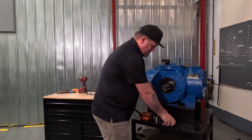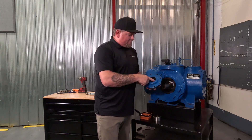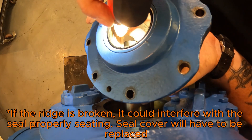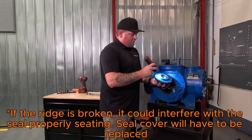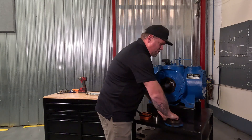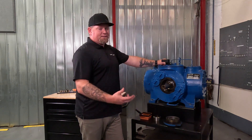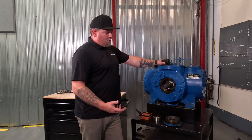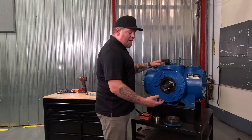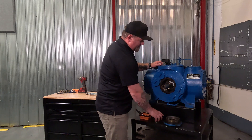With disassembly, pull out the inner race. You might need to come in from the backside and knock it out. One thing that's very important to remember is that there is a ridge inside that's part of the housing — make sure you get the seal and not the ridge in the housing. Remove the inner seal, then remove the lip seal, which also has to get punched out. Replace and remove the O-rings. Clean everything, put new O-rings in, and lubricate with clean fresh refrigerant oil or the same oil that's in your compressor. Lubricate the seal faces, then begin your reassembly process.